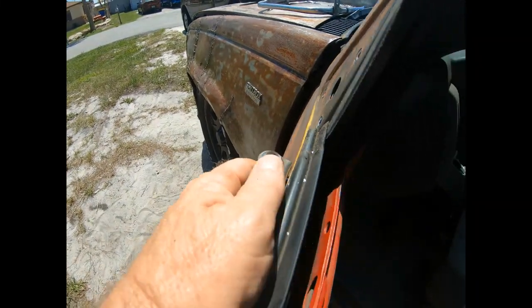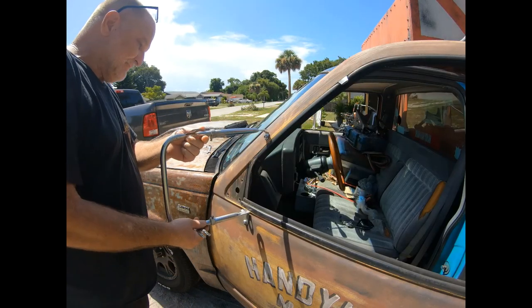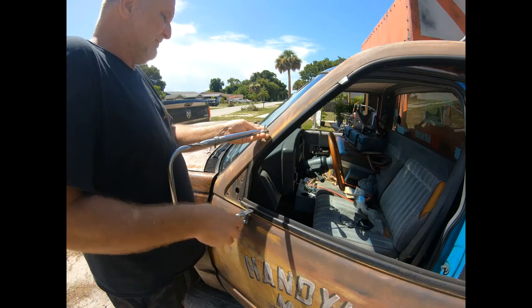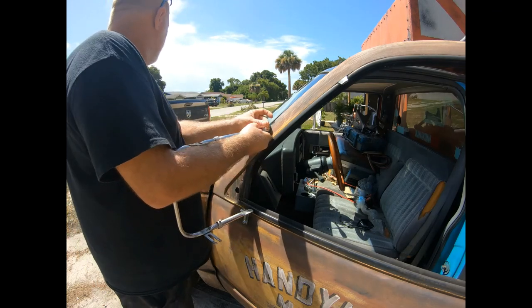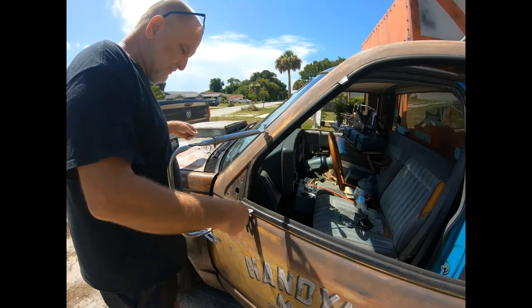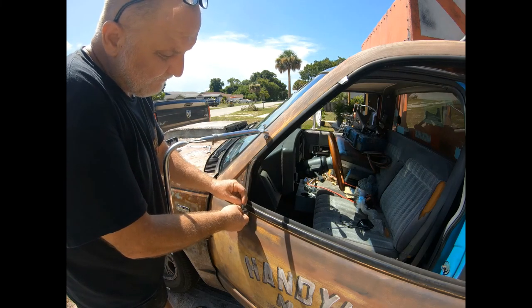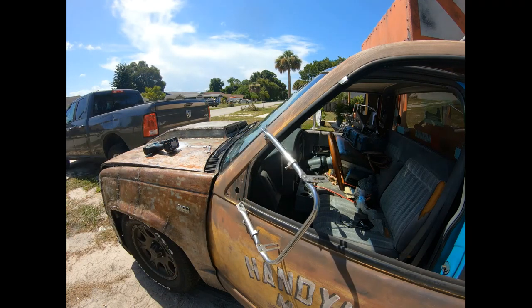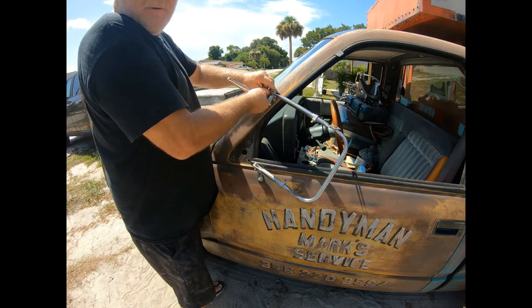On this bottom bracket — I don't know if we can see it — but I drilled right through where there's a double wall of steel. Here's the hoop, so I'm going to get that on there with a long bolt there and a short bolt down here. Let me get some wrenches and snug all this up. These are my favorite quarter-20, so everything's 7/16 — 7/16 wrench, 7/16 ratchet, and away you go.